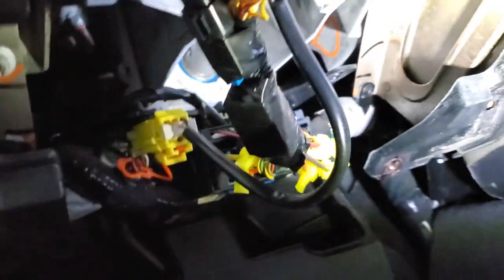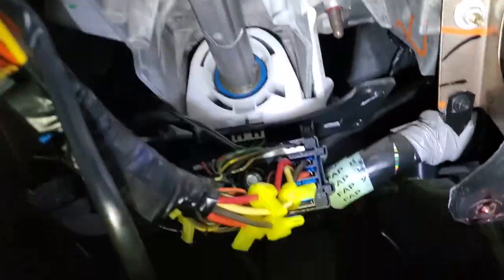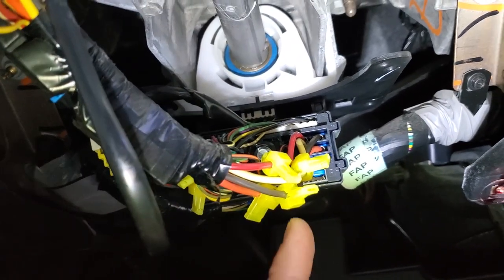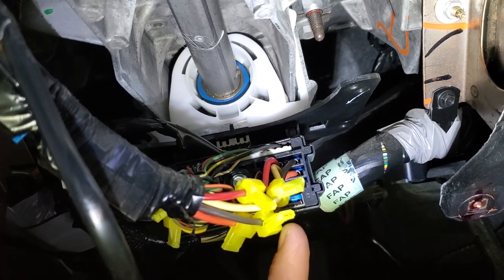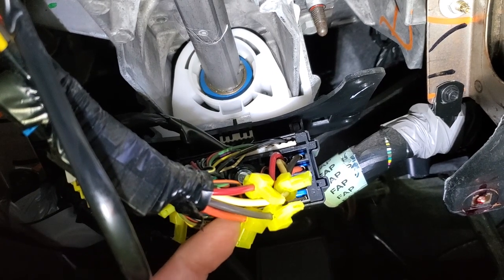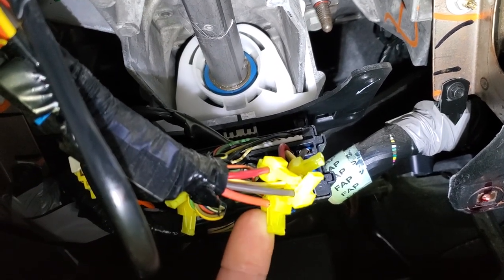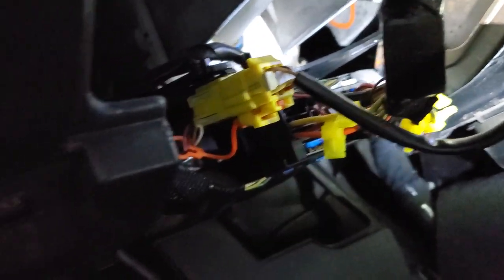These are your wires right here. We've taken off the bottom shroud — you don't need to remove this plastic, we were just double-verifying our wires. If you look over here: red is going to be your constant; white, even though it looks yellow, is going to be ignition; brown is going to be accessory. This wire right here is actually pink, which is ignition, even though it looks orange — we actually tested it. Then on the other side you have yellow, which is starter, and orange, which is accessory. Those are going to be your wires.